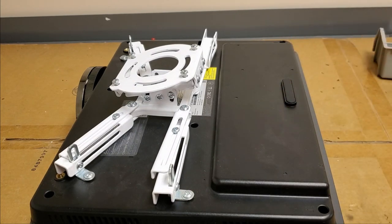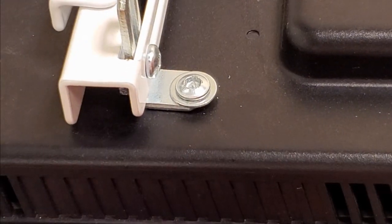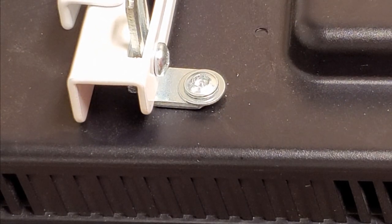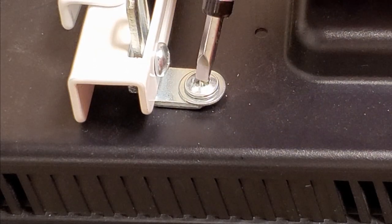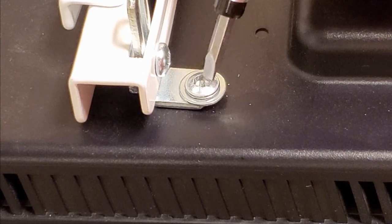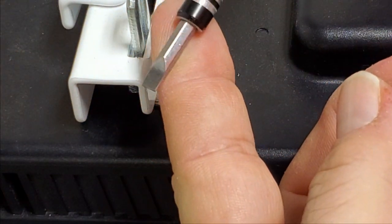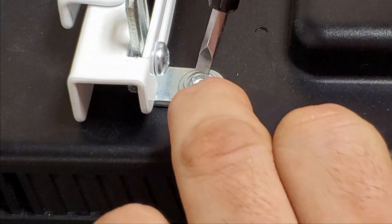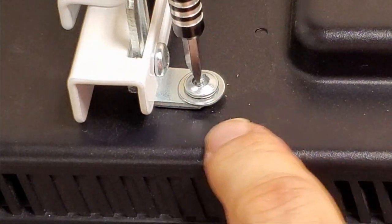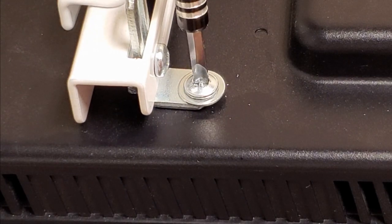So let's zoom you guys in. And if you haven't seen this done before, then it's a good thing to know. These are actually one of the most insecure security screws. They have that little nub in the center, and then it's a hex shape on the outside. This one I already cracked loose, but what you do is you get a flathead screwdriver, and you get one that is just big enough to get stuck in the edges and then push against that pin.